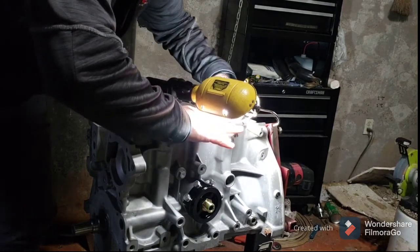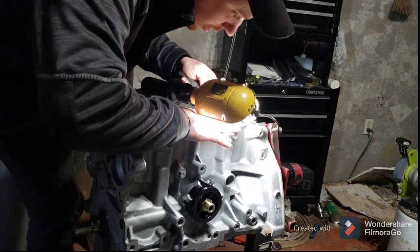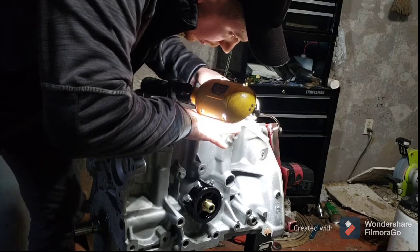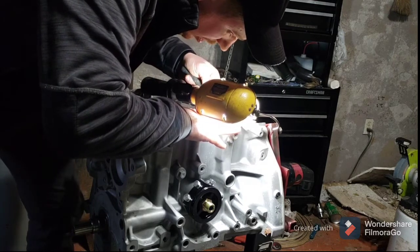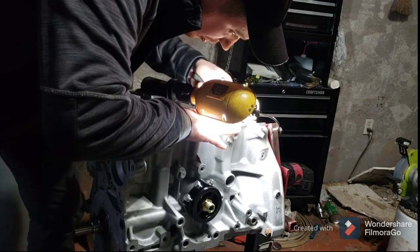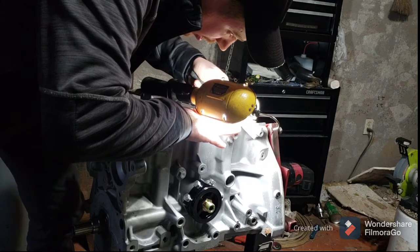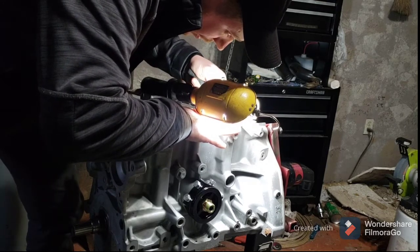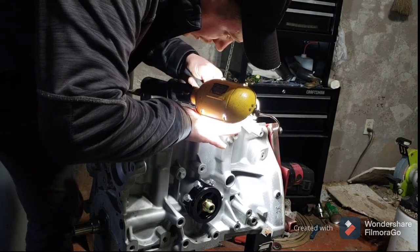I'm using a diamond file. It's not real coarse, it's pretty fine. It takes a little bit of time. It's real time consuming. You want to file in one direction. Honestly, I'm filing toward the outside when I should be filing toward the inside. So don't jump me for this. But I'm going along and I'm taking my burr off when I get done with it, and just barely nick the edge of it.